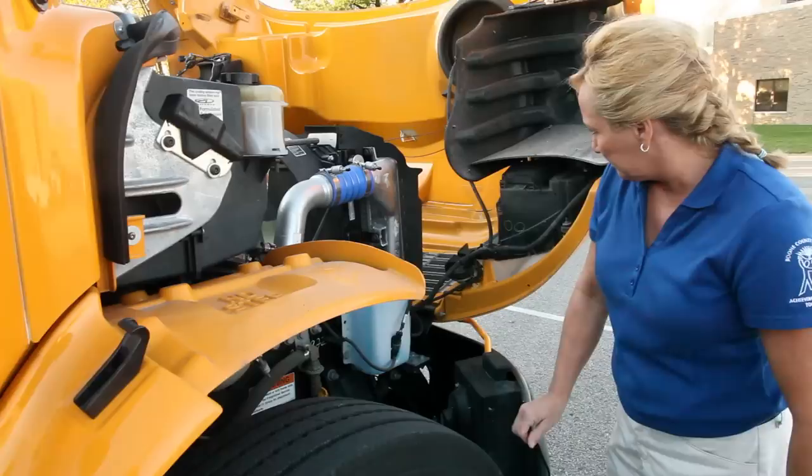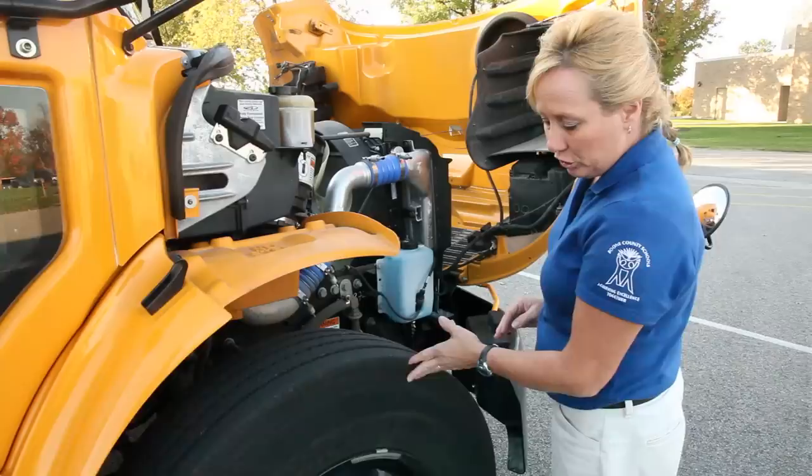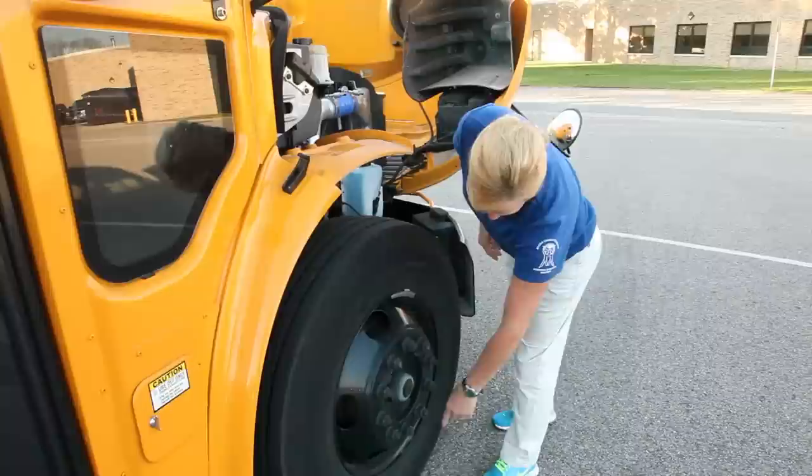You want to check out your tires. Make sure the depth is at proper level, make sure they're not bruised or damaged, and they have proper inflation. Look at your drum and all your lug nuts, making sure your lug nuts are properly secured and do not have any excessive rust trails or shiny threads. Make sure your hub oil seal is in place and it's not leaking. Your valve stem is in place, cap on, and it's not leaking.